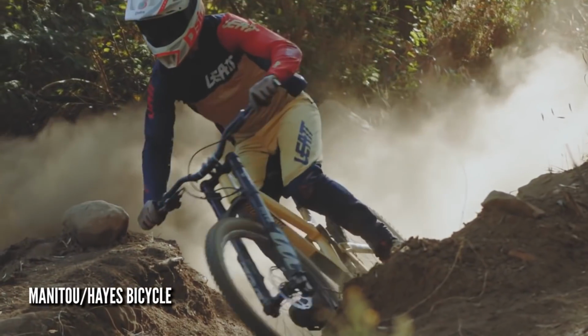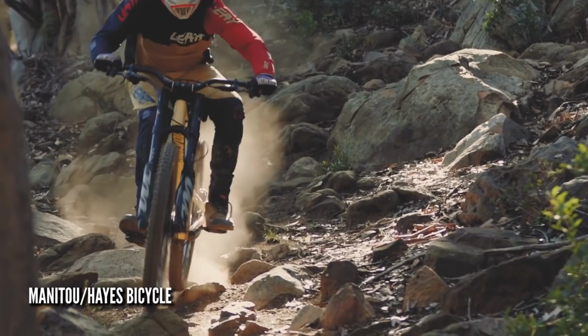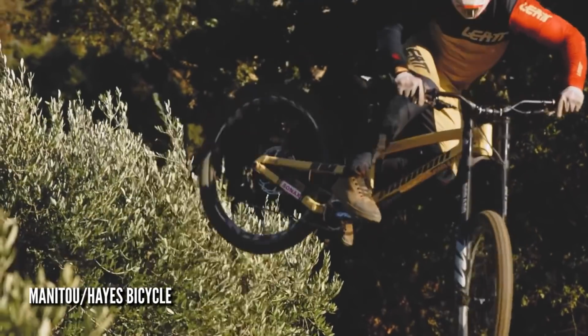But there's some really cool things you can do with an inverted fork design. Of course you can have it nice and stiff at the top, which is great. It also means that the fork, technically on paper, is going to work better for longer and is going to be very, very slick and slippery because the oil sits around the stanchions, around the seals and around the bushings, way more so than it would with another fork. It requires a sort of capillary action to keep the oil in place, to keep those seals lubricated. Obviously, on an inverted bike, because it's upside down, it sits on them.